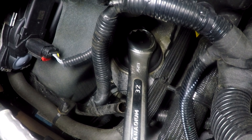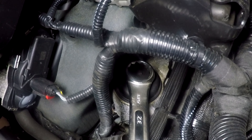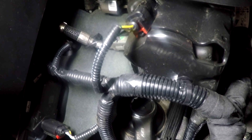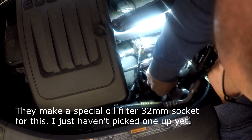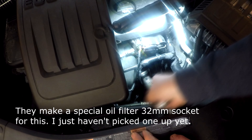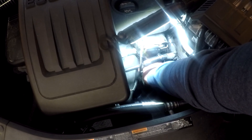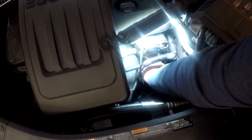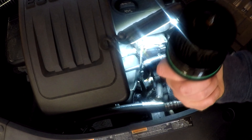I'm not sure if I'm going to have enough room to unscrew that cover, but honestly they really don't make this easy so the average person can do their own maintenance — they really want you going back to the dealer. But that's not going to happen here at the Tech and Mobile Garage. So I'm just going to attempt to take it out with that 32 millimeter — here goes nothing. And there's your oil filter.